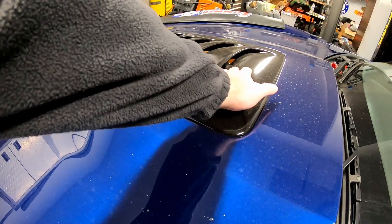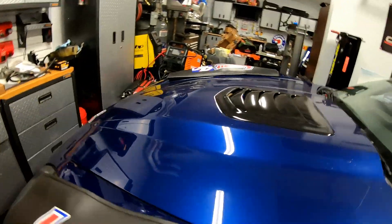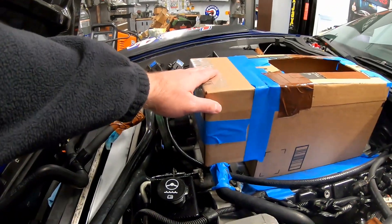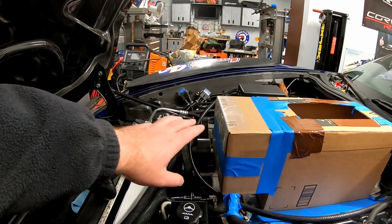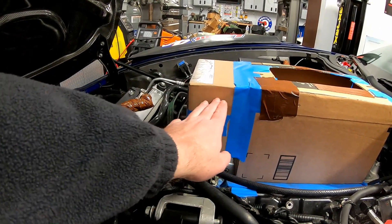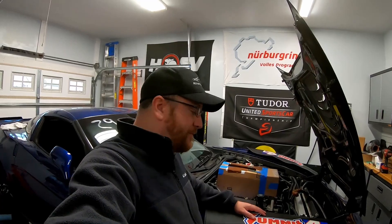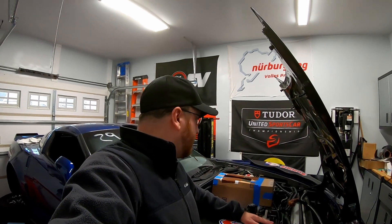As you can see, it does actually physically fit — we actually have more room in the back than we did with the E-Force. The only trouble spot is the very front of the mock-up box hitting the hood, but that's because I made the mock-up as large as possible. In truth, the Harrop blower angles down quite a bit at the front where the pulley sits. Does it fit? Honestly I'm just not sure — we're super close. It's not far off from where the Edelbrock sits, so we could potentially make it work.